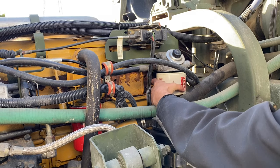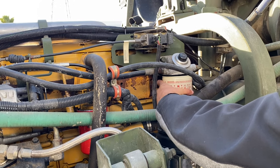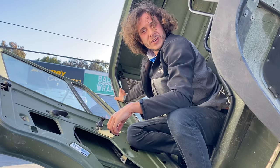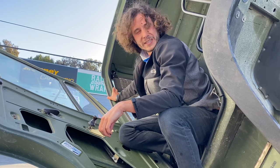And we have contact. With the filter primed, we're going to run it for two minutes, getting that Sea Foam in there. And then we're going to let it soak for 10 to 20 minutes.